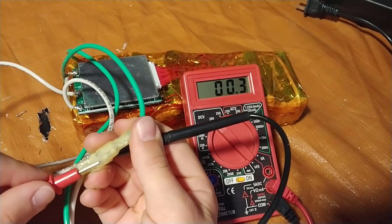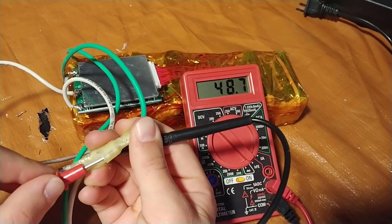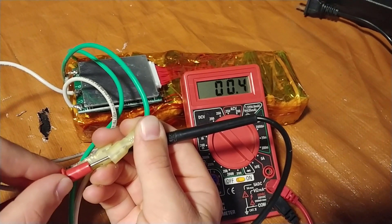Here I'm about to check the battery voltage. It's doing pretty good — it's 48.7 volts, right around nominal. This doesn't explain why under load it drops to zero.